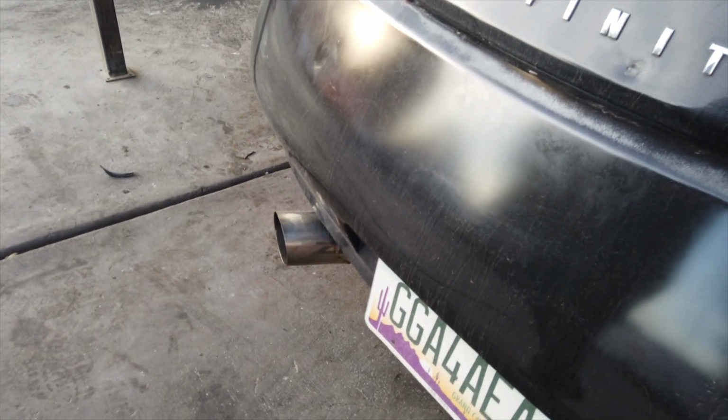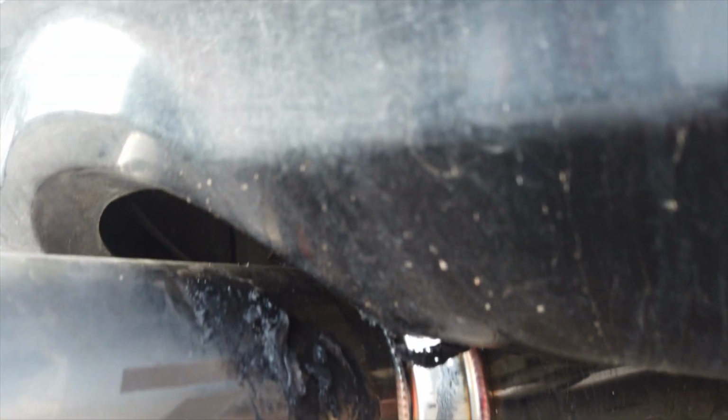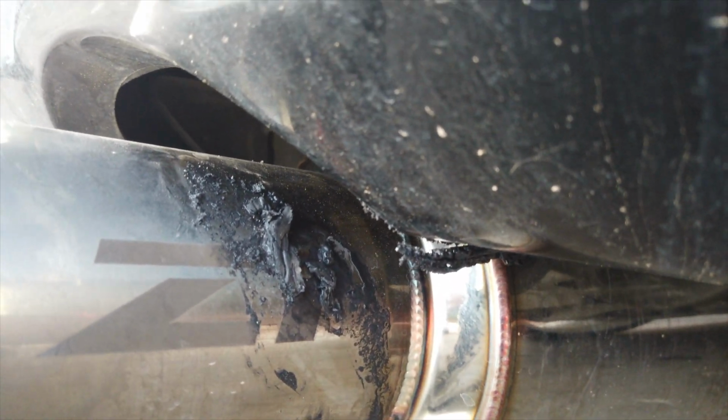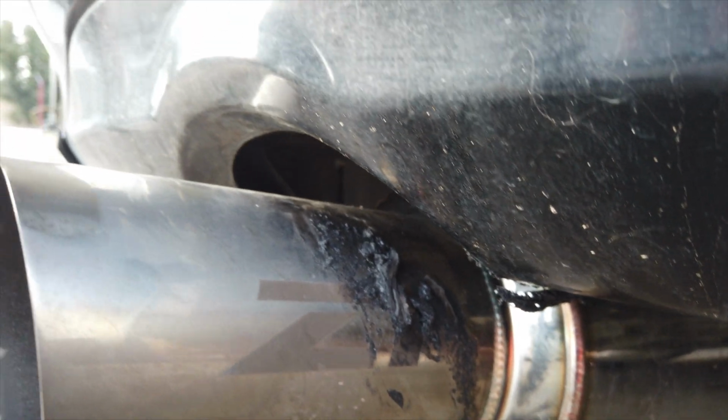Oh yeah, I forgot about that. And next week, I get paid, and I'm ordering bash bars, front and rear. Are we taking off the bumpers? Yeah. We're taking off the front bumper, cutting the rear. We already have to cut the rear because the Z1 Motorsports exhaust melted it. It came with a bracket to hold the muffler into one of the hangers, and we didn't think we needed it because it was sitting pretty tight when we put it on, and it just drifted its way over and melted the bumper. It looks cool though. There's more room. Oh, that's hot.